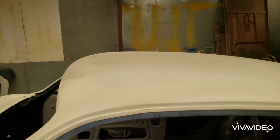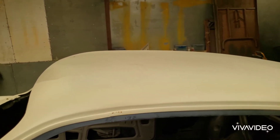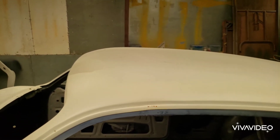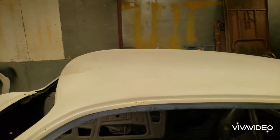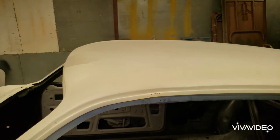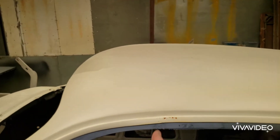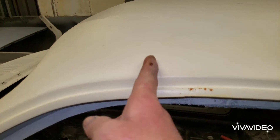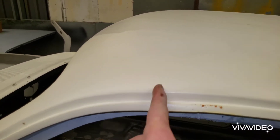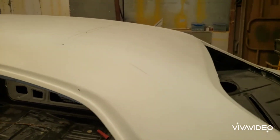I know there were a few dings in the roof. I'm going to spray some guide coat over it all after I get it cleaned off and take a block to it with some 180 to see where the dings are, then fix them. I know there was a little one on the other side right about here — looks like something like a stick whacked it. It's a small dent running like that.